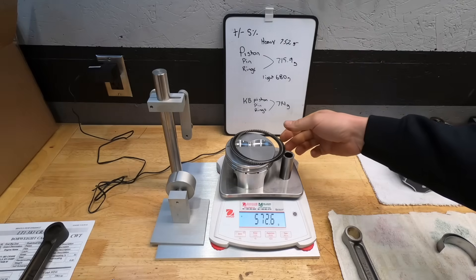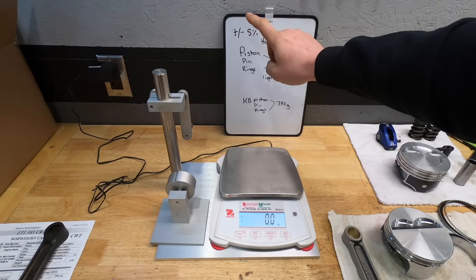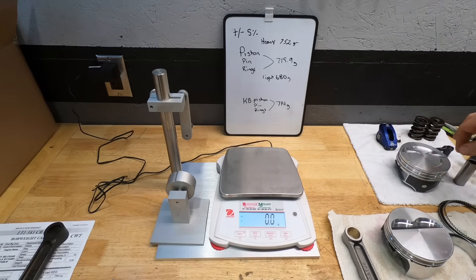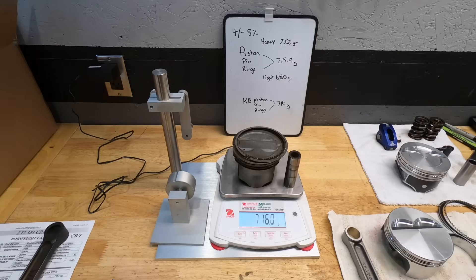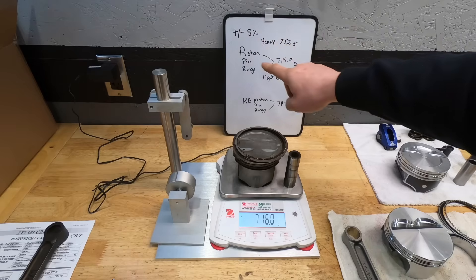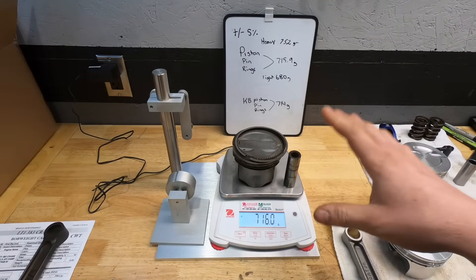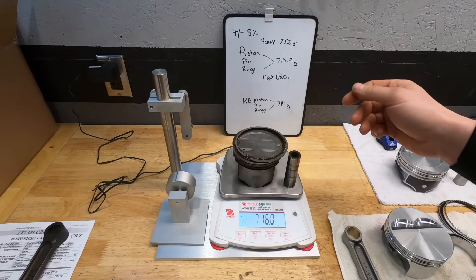So that's a lot — but is it bad? The rule I go by — and I'm sure people will have different opinions — is plus or minus 5% on the reciprocating mass. This is assuming your balance was good before with your stock crank and stock rods and you're just swapping pistons. So for example, the stock piston with rings comes in at around 716 grams. Plus 5% would be 752, minus 5% would be 680. That seems like a lot, but this makes only a small difference in the bob weight because the piston is only included at a 50% factor — so it's really only about 2.5% when you think about it like that.